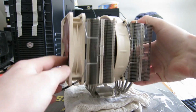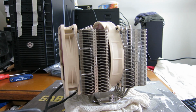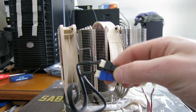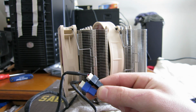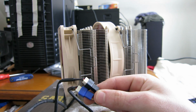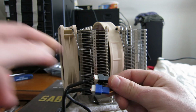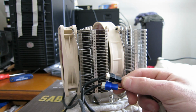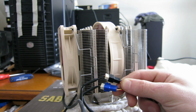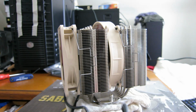The only thing that I can say is that at least on the two that I have, maybe the fans that come with the LGA 2011 version have PWM, but the original version, or whichever version I have, do have 3-pin. I found that a few motherboards I've worked with, the M-Power is one of them, the Sabertooth is another one, they will control 3-pin on the case fan headers. On the case fan headers, they can control them, and that's okay. But on the motherboard fan headers, they will only control PWM properly, and they don't seem to control 3-pin properly. Now, I'm not sure exactly why that is, but that's what I've noticed.